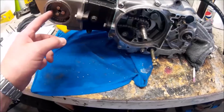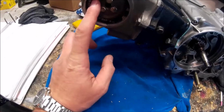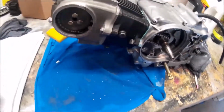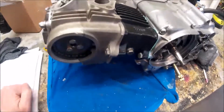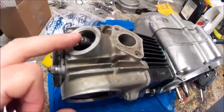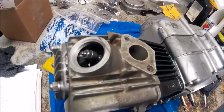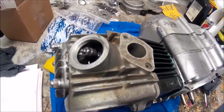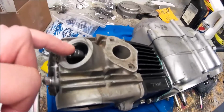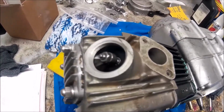And on the cam gear, there's a 0 right there, and you gotta make sure that's up top. So it lines all the way down. That's top dead center. So while you're there, you may as well adjust your tappets. So the book here for me says to set it at 0.002 inches with a feeler gauge, and I set mine at 0.003.